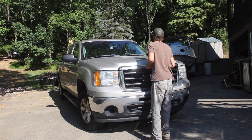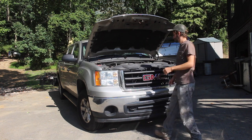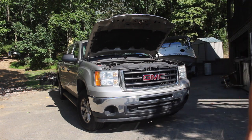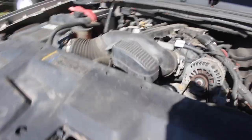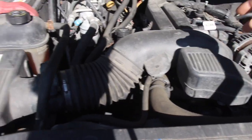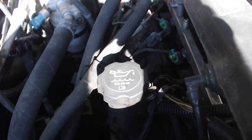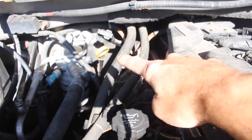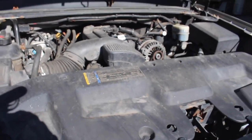Pop the hood. We've got the engine running now still. On this engine there's typically a cover on top — I took mine off. On the left-hand side here is your oil fill. It's a 5W30. And your oil dipstick is the yellow dipstick right there. Let's get an oil pan and we'll crawl underneath and drain the oil out.